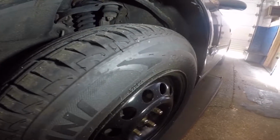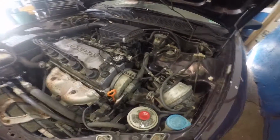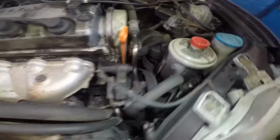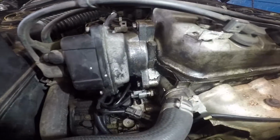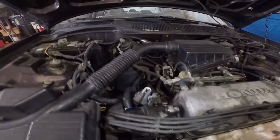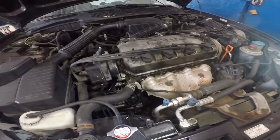So I'm recommending this car, as long as the buyer is looking to do a timing belt, water pump, these belts here, the alternator and power steering belts, and then a couple of leaks here. It might need a distributor O-ring seal, valve cover gasket, tune up, and the hoses, which will give it a coolant flush, which is already done. So you might have to do it again.